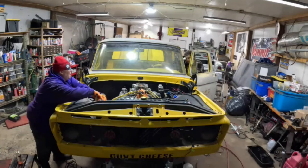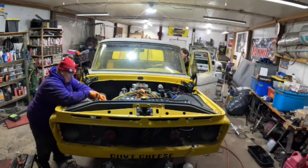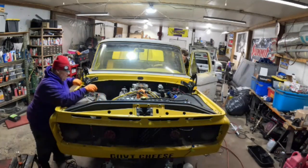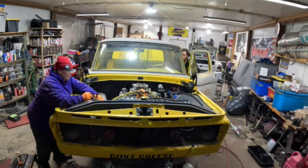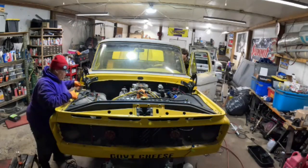Did it have good oil pressure, Kyle? Yeah, it was getting pretty good oil pressure. What was it up to? Almost up to 80 like we had yesterday. Alright. See if this turkey starts with the key, then we'll mess with the gas gauge. Did that blue light go out? No, we still had the blue light and the red light. Yeah, that's the alternator light. It ain't charging. But we'll check that after we get it to run a while. We may have to change the alternator. Who knows?